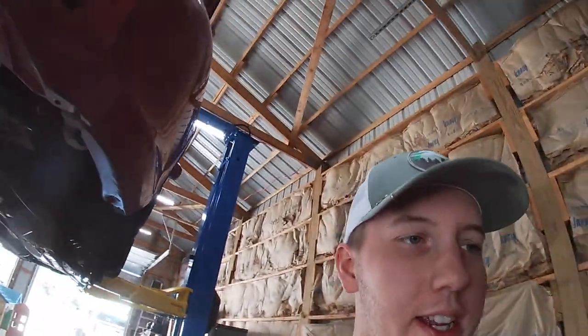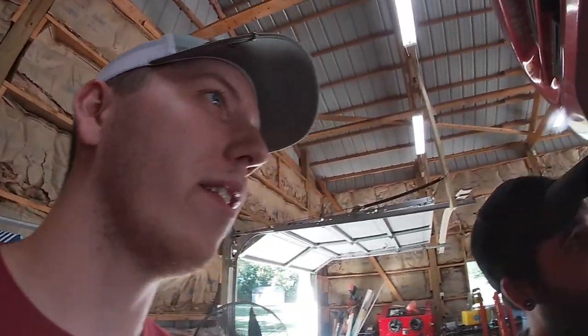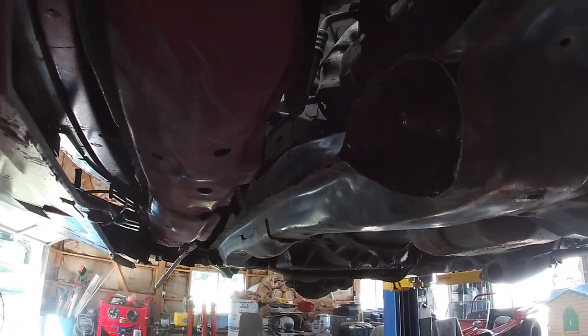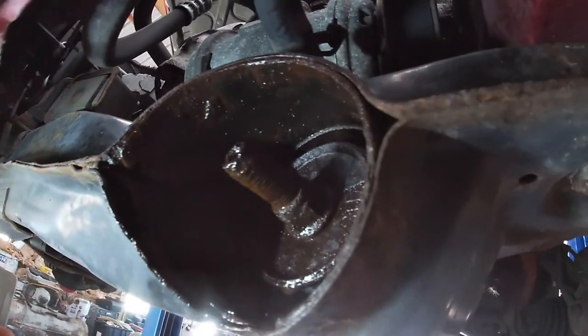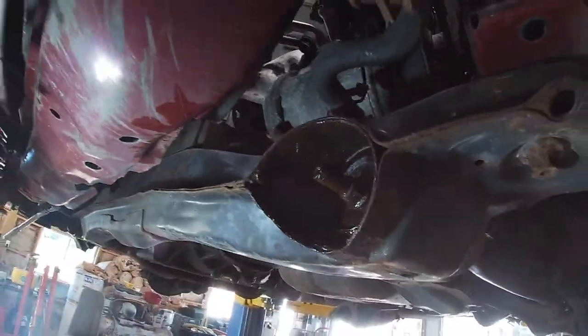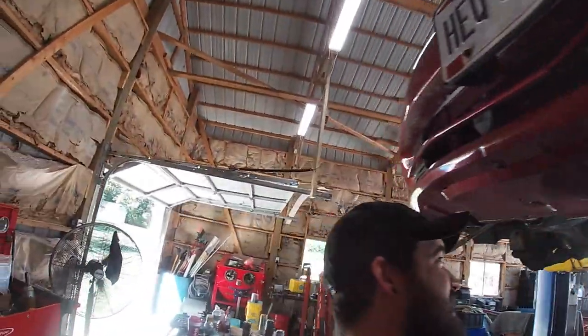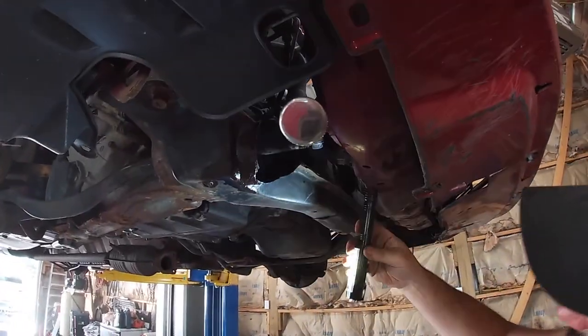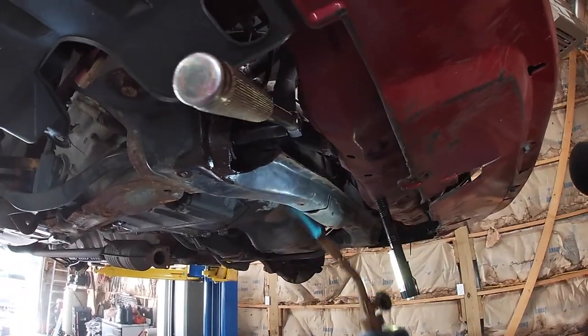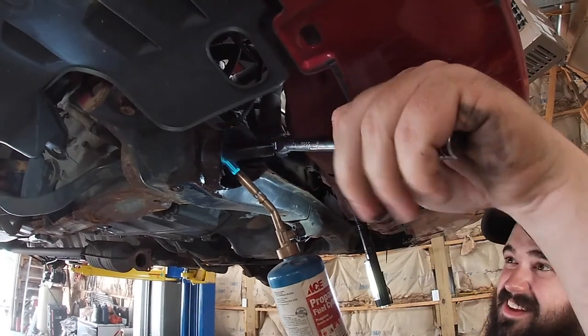So we're having problems getting this. I mean, as you can see, this bushing came out. But if you look at this one, we need a light. If you look at it, there's no threads on there, so we're putting threads on. So you're watching us over here struggle. So what we're doing is heating up the nut to expand it to help it get along.